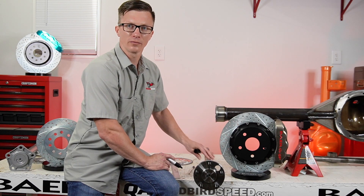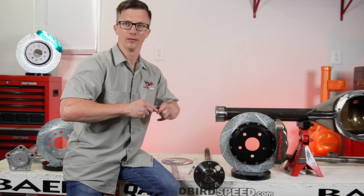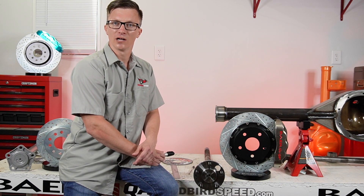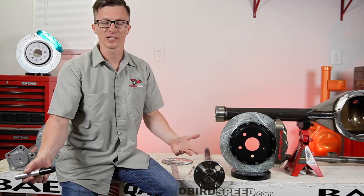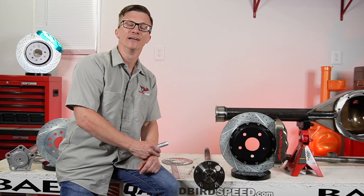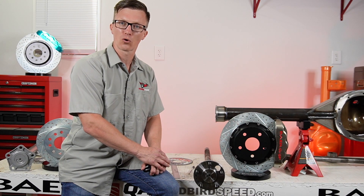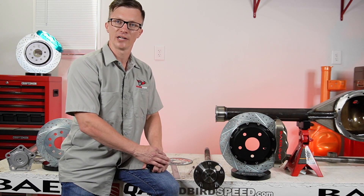When you're measuring your axles, be careful — get the template if you need to, got a link below to buy it. Chevy cars like this four and three quarters — that's gonna be like a Camaro, Chevelle, Nova, S10 — four and three quarters is very popular. On a Ford application, five on four and a half — like a Mustang or an Explorer — those are very common. A lot of aftermarket wheels, people will switch bolt patterns. If you had a set of Ford truck axles with a five on five and a half bolt circle and wanted to find wheels for that, it's gonna be very difficult, so you'd probably have to go to something like a five on four and a half. Any questions on measuring bolt circles, let me know — give us a ring at 260-301-2424, get us at redbirdspeed.com, we're available on all the social media outlets, drop a comment below. Let's talk about some studs next — have a good day.